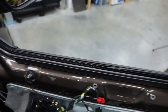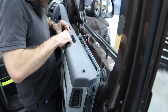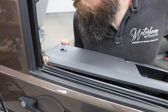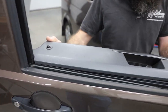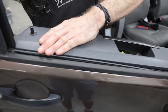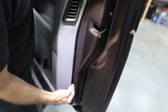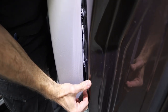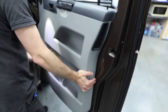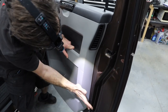This plastic fin is so important — it must be located over the top here, otherwise your door card will not be on correctly and it just won't sit nicely. Reclip the door release. Put your central locking pin down through the hole and release it over. Make sure all the cables for the electric mirrors and windows are pulled up through, and that everything is lining up properly. Putting the door card back on is the most important part of the job, otherwise the door card will rattle.